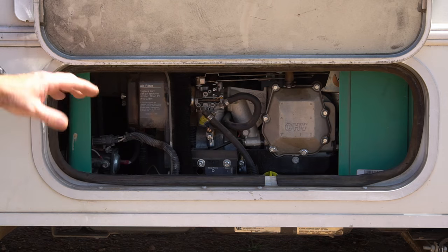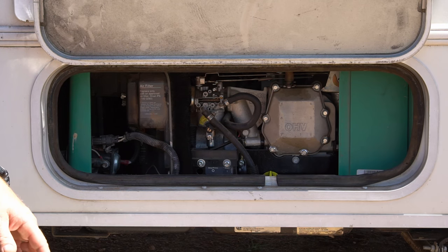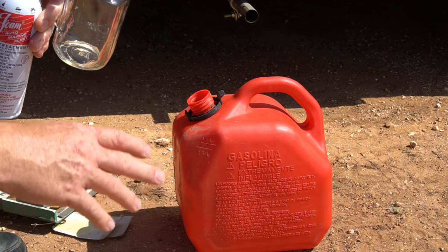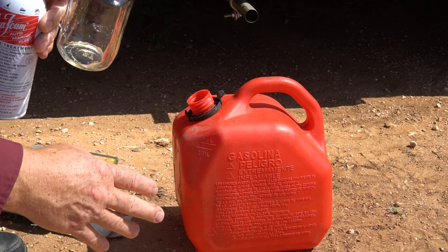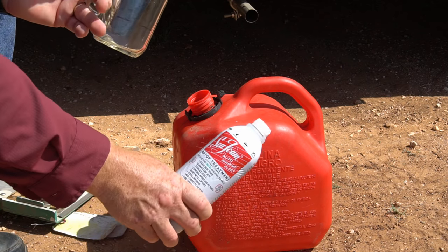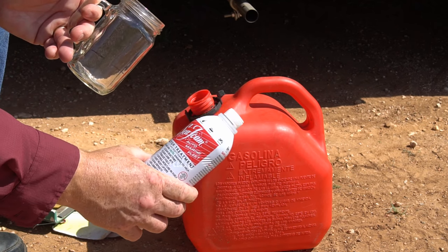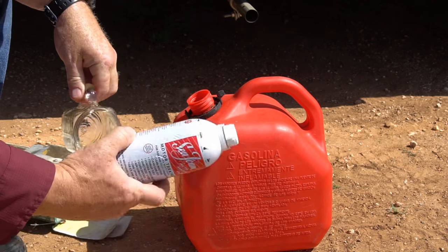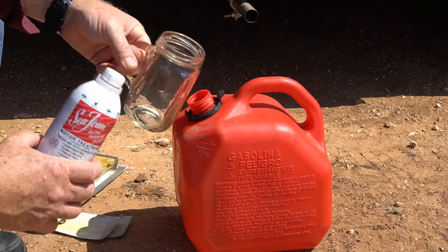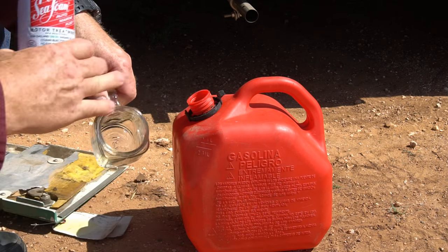What we're going to do is bypass the fuel system on the truck, put in a separate fuel system, and run some cleaner through there to try to clean those jets out. Step one: you're going to need some really fresh gas — I recommend going straight to the gas station. You want high octane, 91 or 92 octane. You're going to use some Seafoam cleaner or B12 Chemtool cleaner — these are top quality carburetor cleaners. This calls for one to two ounces per gallon; I'm going to mix it at four ounces per gallon, double strength, to give some super good cleaning power for a concentrated clean, not a long-term clean.